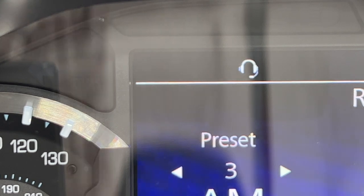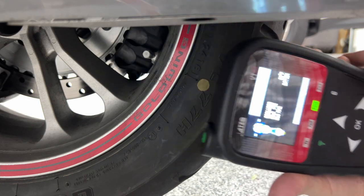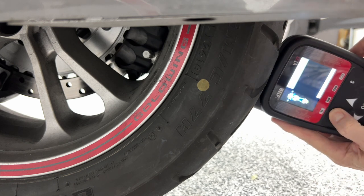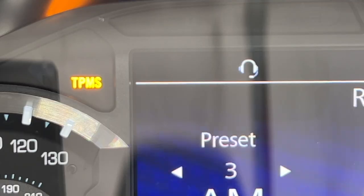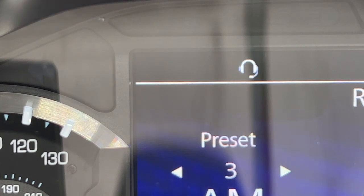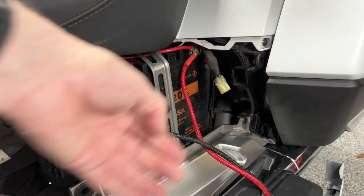You now have one minute to register the rear sensor. I have it set to the rear tire. Put the sensor in the center of the rear tire and press the green button. After you register the rear tire sensor, you'll notice the TPMS light begins flashing rapidly and eventually will stop flashing altogether. You can now turn off the ignition. You have now successfully registered both tire pressure monitors to your Goldwing.